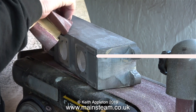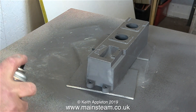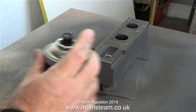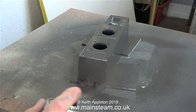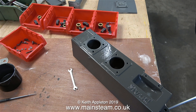Now it's ready for painting. Even though there isn't too much bare metal showing, there is some, so I'm still using etching primer — I want this paint to firmly stick to this part. It's a bit cold for painting, so as soon as I finish I'm going to take it into the warmer inner part of the workshop. I need to ensure full coverage without any drips, runs, or sags. The base is on two pieces of wood, which makes it easy for me to rotate it to paint the other side. I'll leave this for 24 hours for the paint to dry. That is it for this episode — stay safe, stay healthy, thanks for watching, and I hope you found it useful.